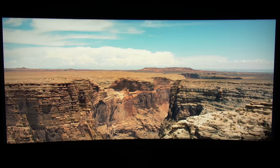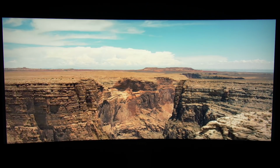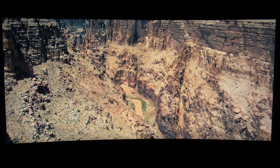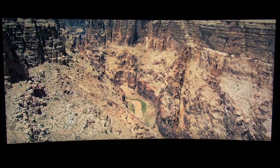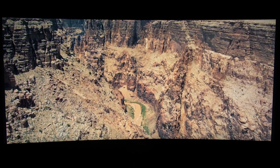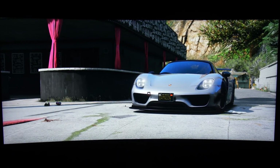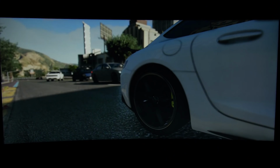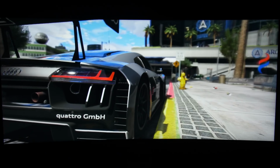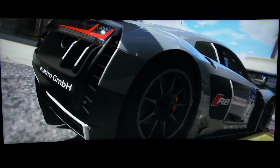If you're a photo or video editor, then this display may not be quite what you're after. While the colours do look great, it's really a consumer level product and may not be up to the requirements of a professional workflow. The huge widescreen format is wonderful for video editing, but you may be limited by the colours. There's no Rec 709 or DCI-P3 coverage figures, and it's not calibrated for colour out of the box. There's also been reports of slight colour cast between different production runs of the same monitor. None of this is bad from a consumer standpoint, but if you're a professional who depends on colour, BenQ's other offerings such as the EW3270U may suit you better.